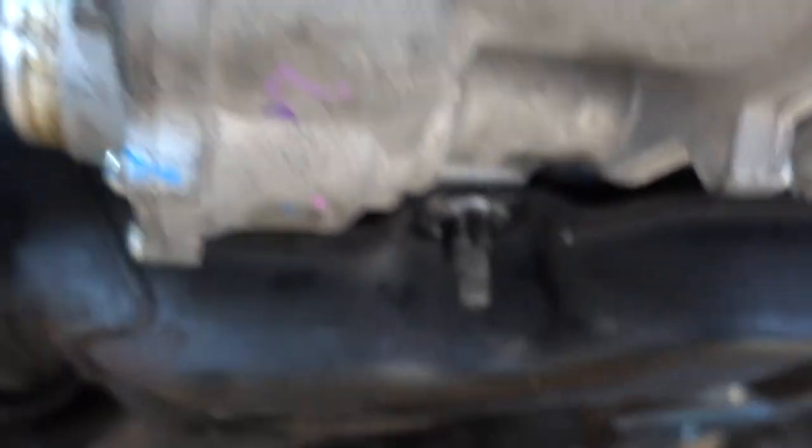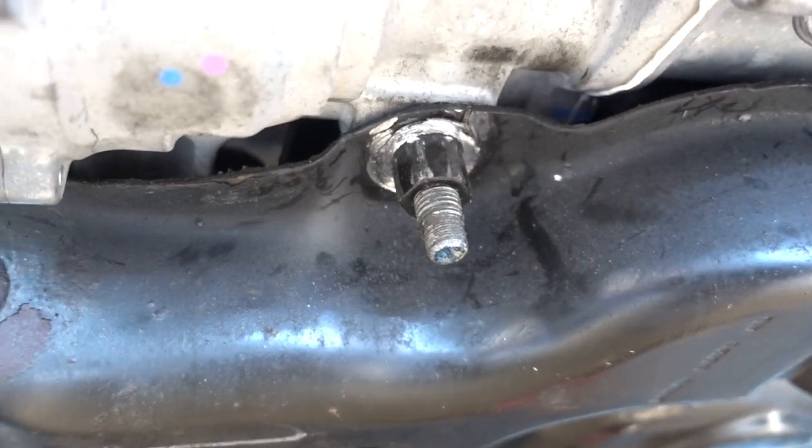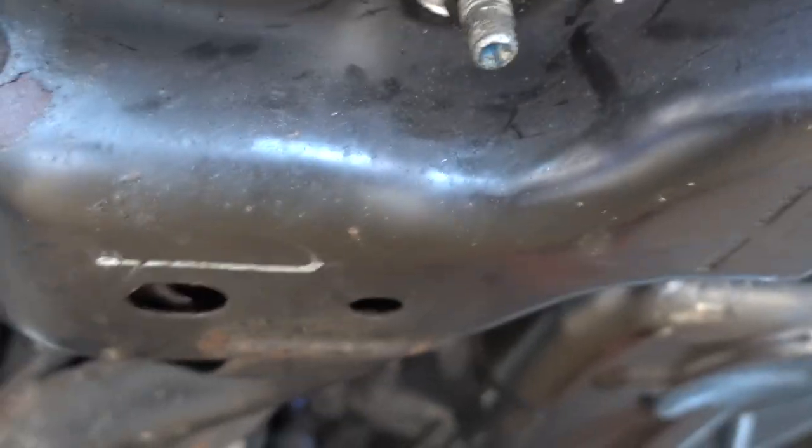If the motor was out it'd be a lot easier. But by drilling out the welds on the bottom nut, you can just take your impact, put it right on the bottom, then get a wrench to hold the top and spin that thing off. The two bottom ones I wound up doing that and got them off super easy.